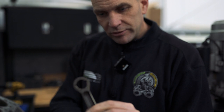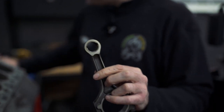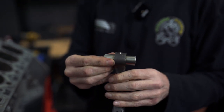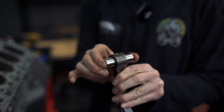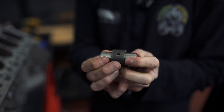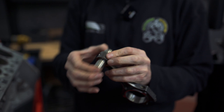This older type design doesn't have any oil channels in the small end bush. Around 2008, engines had an oil channel added. Some of the noise we heard could be the pin rocking in the con rod when heat expansion takes place. On this particular one — though you won't pick it up on camera — I can already feel play in there. It stands to reason that when fully warm and heat-expanded, this is going to exhibit a similar ticking noise to what we just heard.